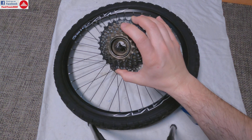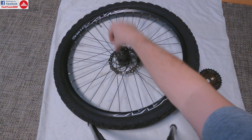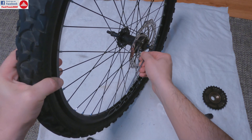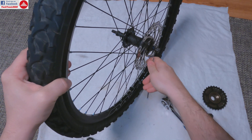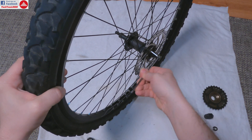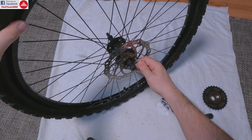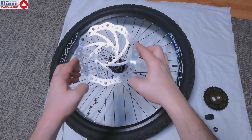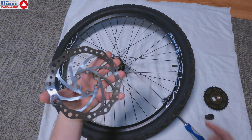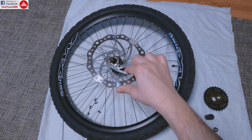The gears are off from the wheel. You can order the motor with screw mount or cassette type — this one is freewheel type. Now on the other side of the wheel we are going to remove the brake disc, which uses hex screws. With all the screws out you can take the disc. Caution with the disc because there is some grease there — you don't want grease to reach the disc as that's going to affect the brakes. Try to keep it clean and not put your greasy hands on the friction part of the disc.